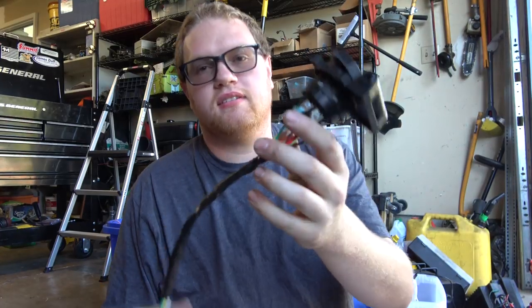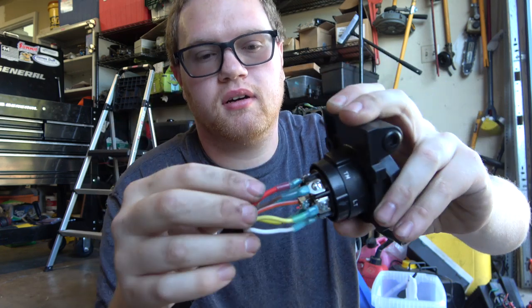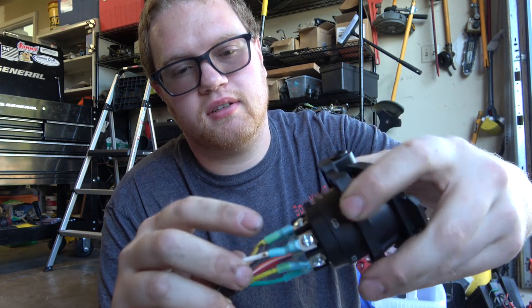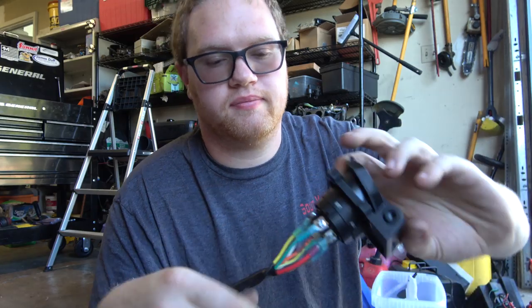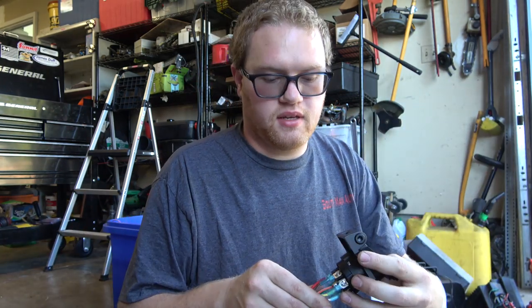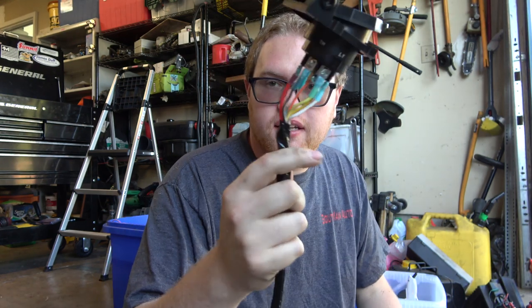She's fully utilized. Auxiliary is power coming from the car, we've got a right turn, electric trailer brake lead, ground, left turn signal, tail light, and the center post is a backup light — this orange wire will go to the reverse light signal. On the trailer I'm going to add LED lights in the back so when you put the car in reverse the trailer is going to light up. I'm also putting light bars on the trailer.